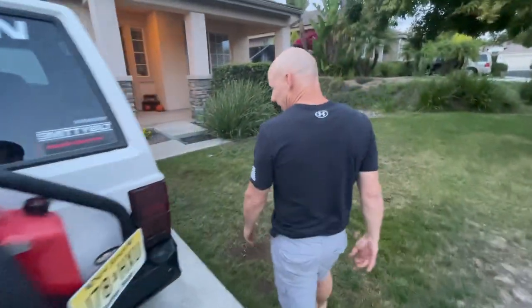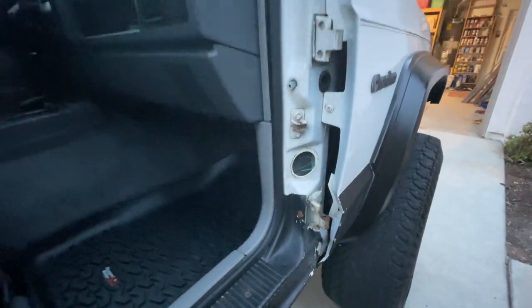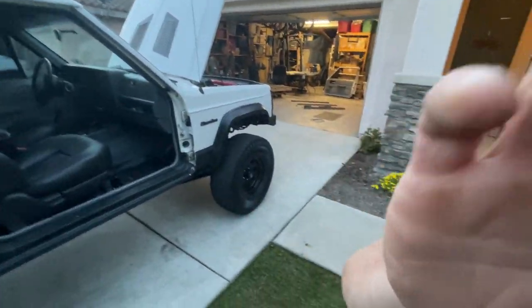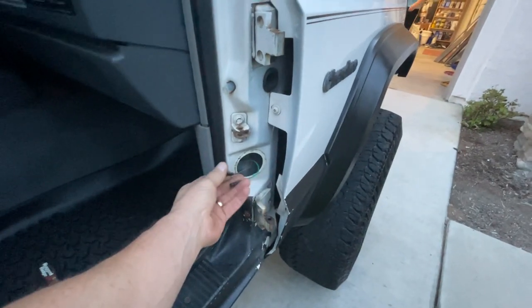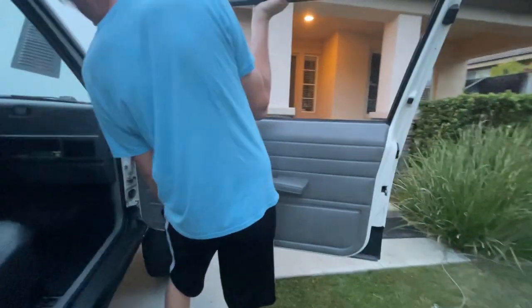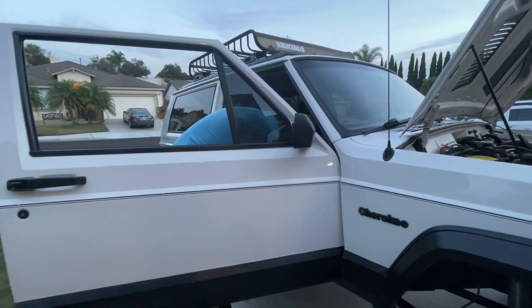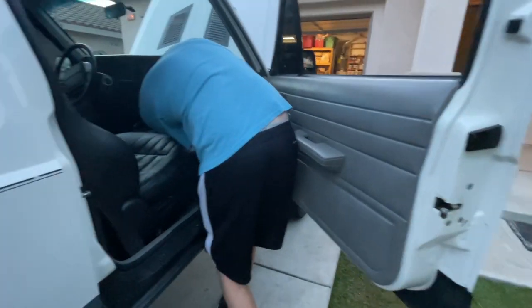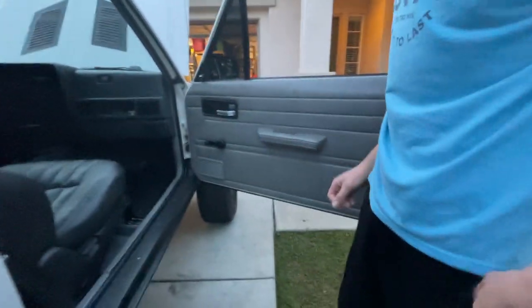Here's a surprise — in Southern California you've got to have the doors off, so he did a hinge modification so he can slide the doors on and off. He also did a quick wire disconnect for the speakers. Watch how easy it is: he lines it up on the hinge, drops it in — and that's it, it's on. He hooks up the wires for the speaker. There's a pin that goes into the door release — normally it's more permanent but this one just drops in, so you'll hear a click when he shuts it.